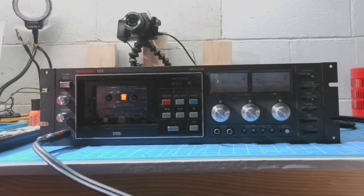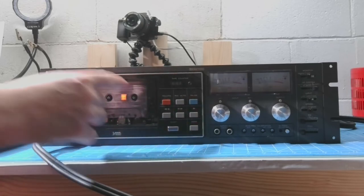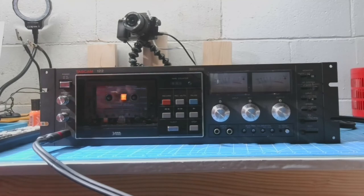The next step is to check all the mechanical alignment. Make sure that the motor is turning at the correct speed and that it's not fluctuating — either rapid fluctuations or long-term fluctuations called wow and flutter. Make sure that everything is engaging properly, that the head is moving up against the tape correctly, and that the pinch roller is pushing the tape against the capstan and moving it along. Also, in fast forward and rewind mode, that the wheels spin at the correct amount of torque — not too much, not too little. You don't want to stretch the tape or break the tape, but you need enough to pull the tape through the cassette mechanism.